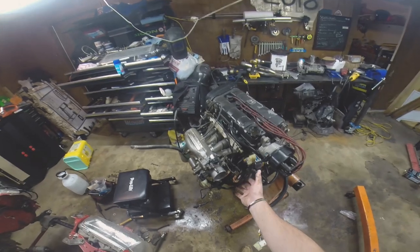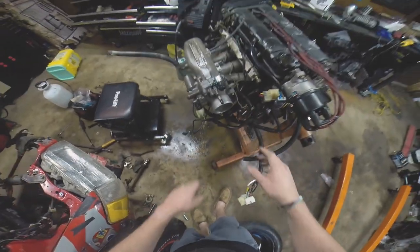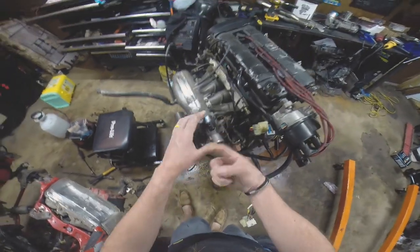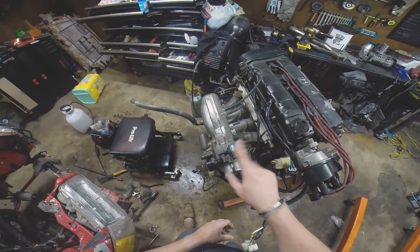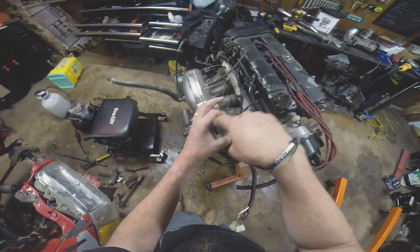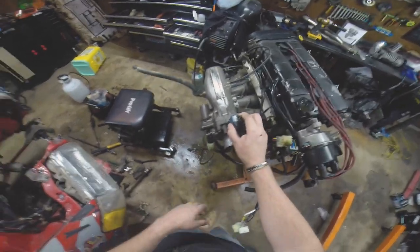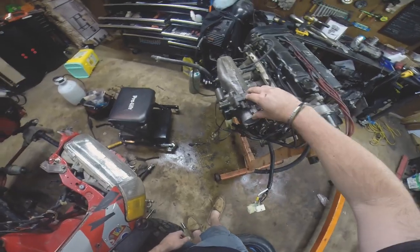As far as the motor goes, there are some things I need to clean up — a lot of things I've been meaning to do. I need to delete this little pipe here and reroute this around, loop it. I've got a new MAP sensor but this MAP sensor actually doesn't fit. I kind of jerry-rigged it so it would work — the port is bigger than the actual MAP sensor so it waddles around in there. I ended up sealing it with a rubber hose, which is probably not very accurate and was probably hurting my tune a little bit.